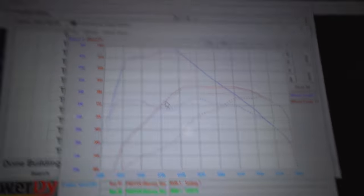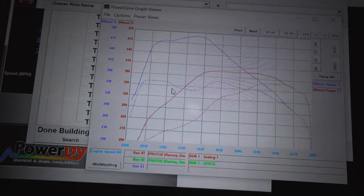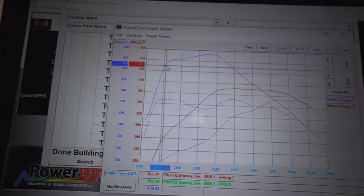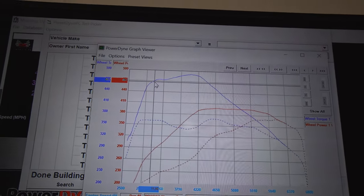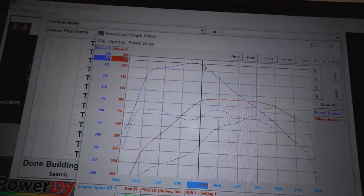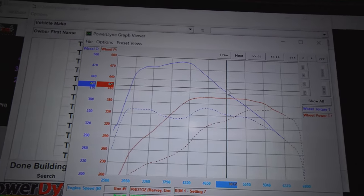The dip is completely gone — that is pretty crazy for just a plug and play tuning box, no hassle. Torque comes in as the turbo starts spooling up and you are climbing immediately. That means your zero to 60 tire-shredding pulls right in from 3100 RPMs. Even at 5000 RPMs you have about 410 pound feet of torque compared to 350 pound feet stock — a mega difference.